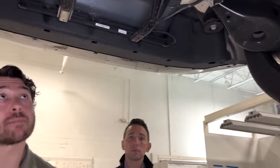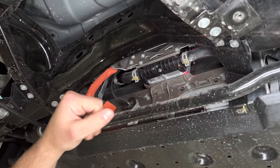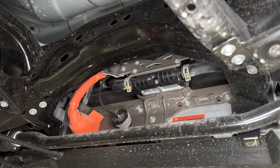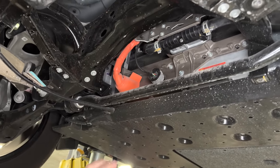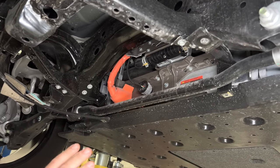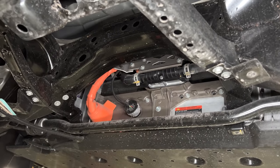In terms of the backside of the battery, Grace, the only thing that's immediately sticking out is the location of the PTC heater, which we can see here. That's going to be used for heating the battery coolant. It's difficult to see where those coolant ports are coming out of the battery pack, but in a cold weather condition, if you need to bring those battery temperatures up, it'll heat the coolant before sending it back through the circuit. That's a fairly conventional approach that we've seen.